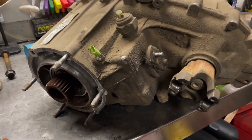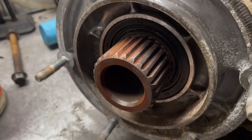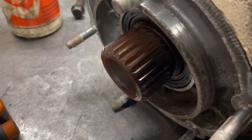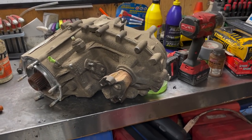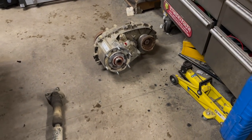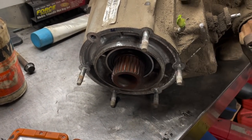Yeah, getting it back up is probably going to be a little more of a challenge. Holy — I'm not going to lie, that job friggin sucked. There's a good look at the coupler for the JK. Not much room to get those top two bolts, especially with this bracket, and you don't want to fiddle around because if you bust that plastic clip trying to get that cable out, you're up the creek without a paddle. There's the electrical connection tied in with it — yeah, she's out, she is friggin out. Now that I've got this on the shelf, another thing I'm not surprised about is that with those splines there's no evidence of any spline lube that should have been put on it. It's rusted pretty good. It's out, it's on my bench — I can get ready to start the rebuild. I've got to be careful when I start taking it apart not to damage anything, in case the rebuild kit seals aren't compatible, since I got the other transfer case from an older JK. Even though it looks the same there are quite a few differences, especially with the input. I was surprised that a bunch of oil didn't come gushing out, which means no seals are leaking — that's a good sign.